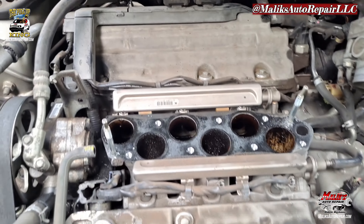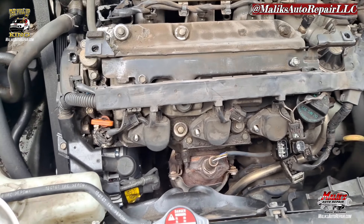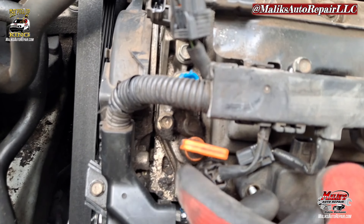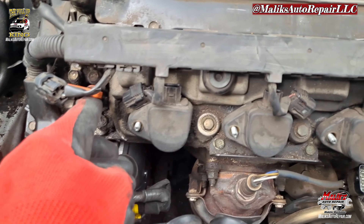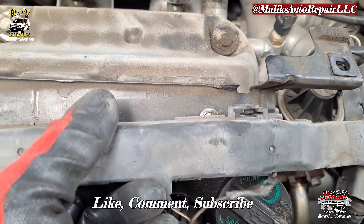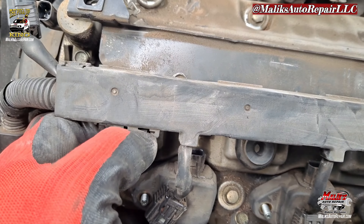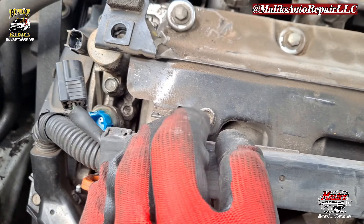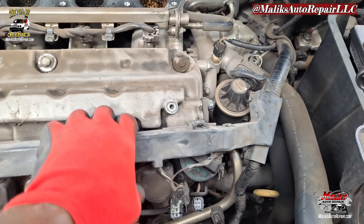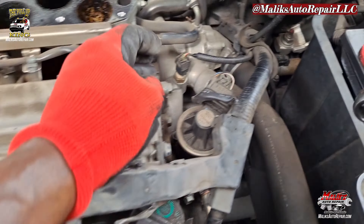At the rear, now we can gain access. Go ahead and start taking this harness away from it. As you can see, I got everything undone. These harnesses here — those two — you got 10 mils holding these coil packs in, so I got all three harnesses. This hooks here and here. Just pry these back and pull up. Got 10 mils holding this bracket — get that off. 10 mil right here, bring this out a little further and unhook this harness.